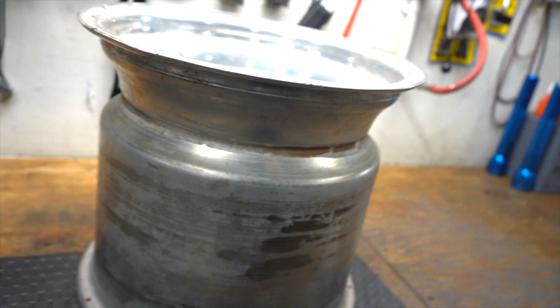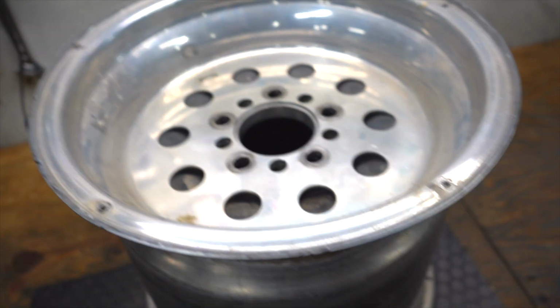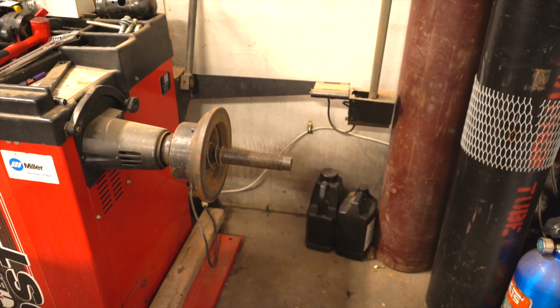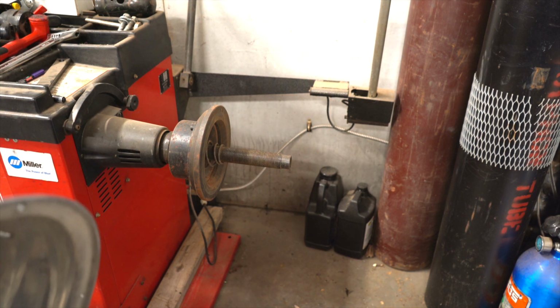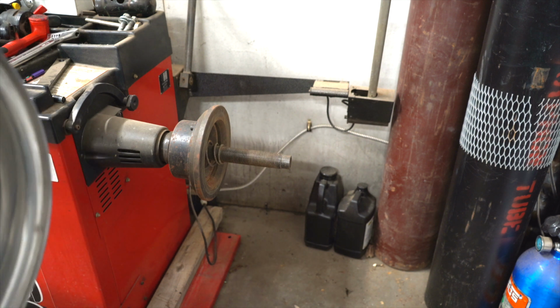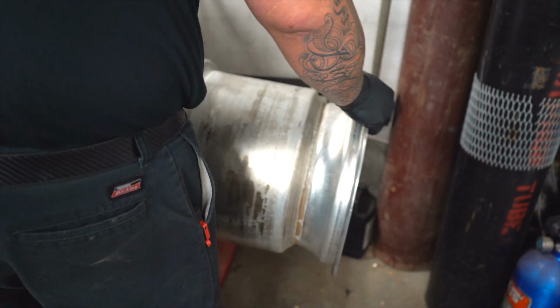So I'm gonna show you guys how I repair this first, and then we'll give it a clean up and a polish and mount some tires on it and get it on the car. Follow me. Okay, now I realize that not everybody's gonna have a tire balancing machine, but this can be done without it. I've done many, many wheels on the ground or on the car. You just bolt this on and use the axle to spin the wheel over and gauge where you're at.